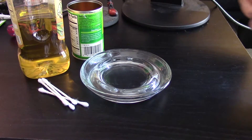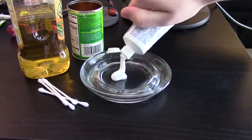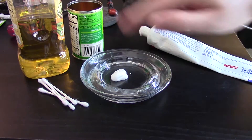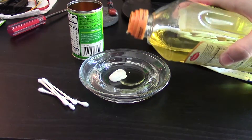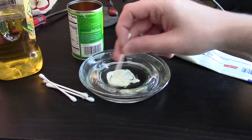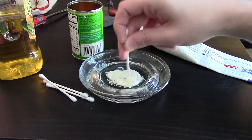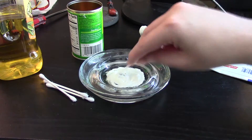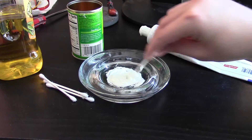Based on what I've read it's supposed to be kind of a 50/50 mixture, and we don't need a lot but I'm going to make a good glob here. The toothpaste is used to thicken it up, the oil is used to keep it wet, and make sure you mix it really, really well, otherwise it's going to get runny and just go onto the motherboard.